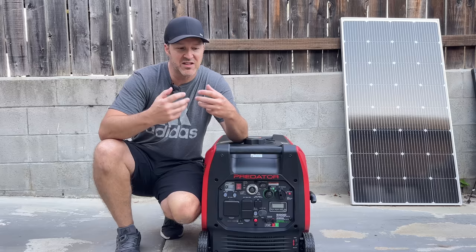Let's see if it does the two presses — and there it goes. Overall, the new Predator did a great job. There were so many things they improved upon from the 3500 to make a really good 5,000 watt starting unit, and the fact that they made this generator really easy to service is something I really like. You can get to all the main key components and take care of carburetor issues easily. It's hard not to find anything I don't like about this unit, except maybe the weight — it is pretty big and heavy. But overall, it's built pretty tough.